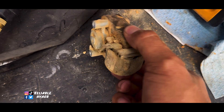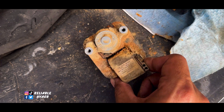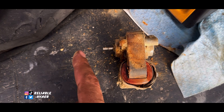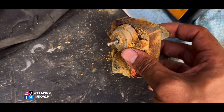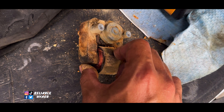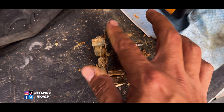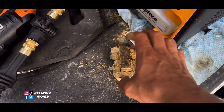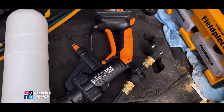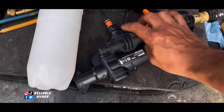I had a bad motor on one — it even fell apart on me trying to get that side disconnected, just snapped off. I can't really use a universal because the shaft sticks out way too much and it's right up against the grill. We're going to order OEM to get one unit going. The other one was misdiagnosed by one of our guys — I think it just needs a good cleaning. As soon as I shoved the brush in there I was able to get airflow; it wasn't breathing before.